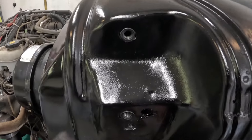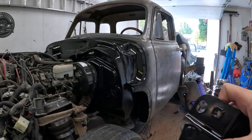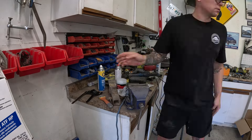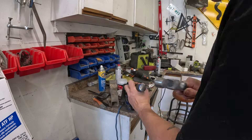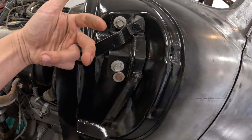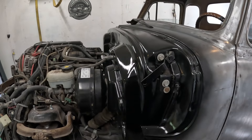You can see I got thread inserts now, and then I'll be able to put the hinge on after I knock out these other threads. Hinge mounted. The third bolt is the factory one — it always went from the outside. The other two came from the inside. But now they all come from the outside so I'll be able to do whatever adjustment I need, move it around whichever way, all from the outside without going under the dash. I'll get the other side done.